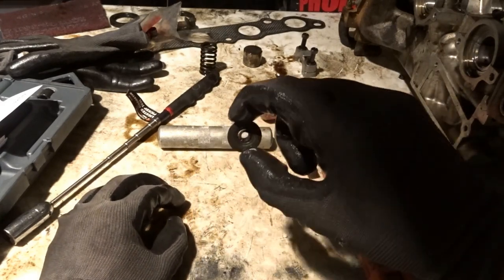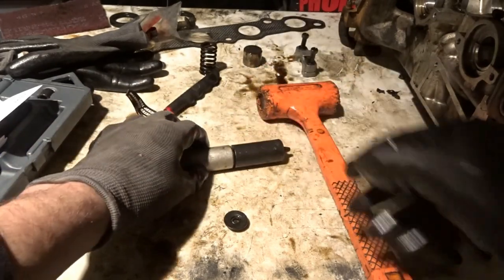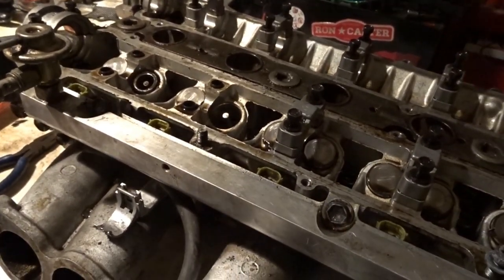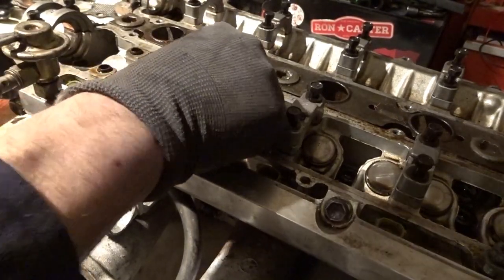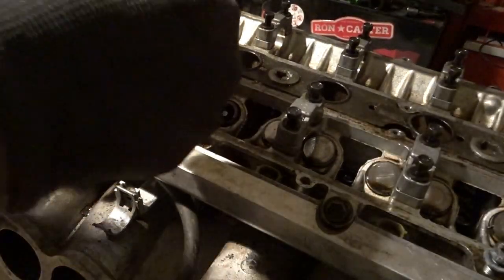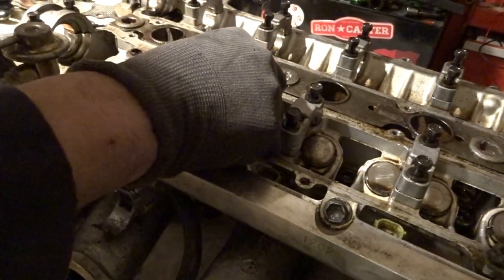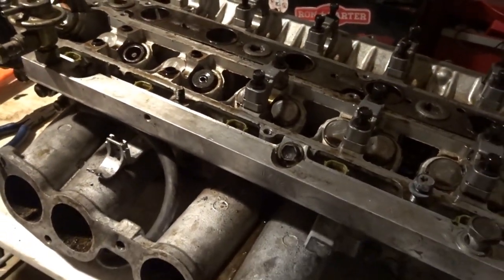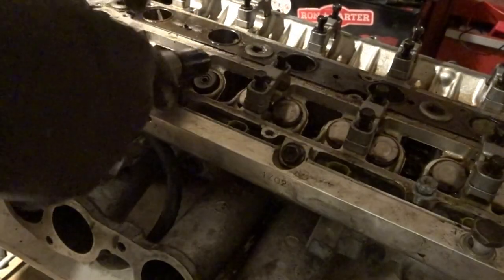Until it looks like that with the clips in, you're going to take the black piece, put it right there, and then you're going to move back over to your valve stem, and then you're going to set your spring back in the correct orientation you pulled it out of, and then I take it with my fingers and I line it up. And this is where the towel at the bottom makes this way easier, because what you're going to do now is take this black piece and put it straight in the center.